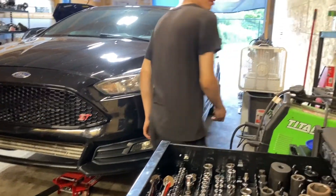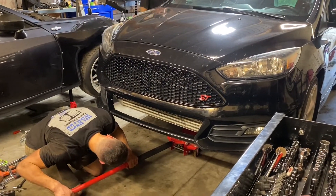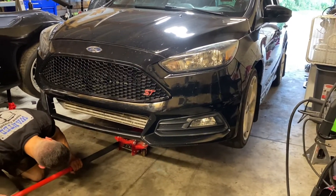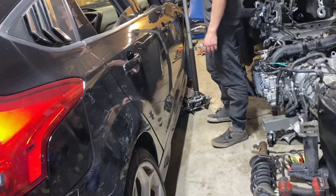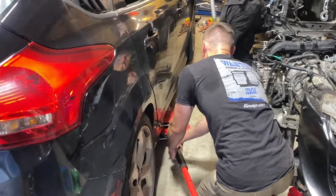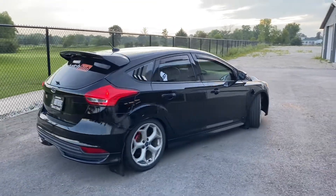I had to cut these because I broke the bolt on the other one, so I'm not even going to try taking this one off. I already cut the spring — the time-lapse didn't catch that. For the shock I used a half-inch MAC breaker bar ratchet with two reliable extensions and a short 15mm socket, because that's what works in that tight area. I already cut the springs as you can see while I'm prying on the lower control arm trying to get them out.